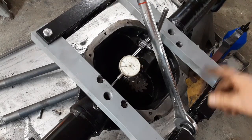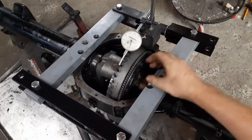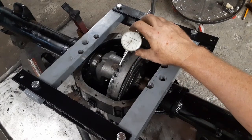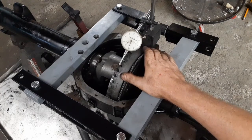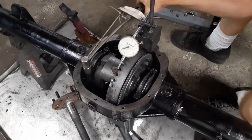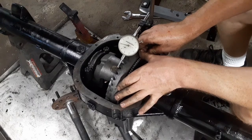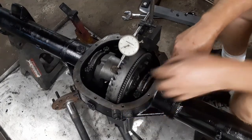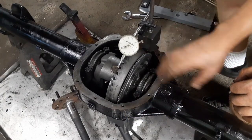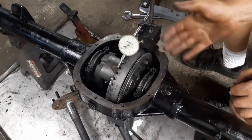So we'll go ahead and drop our carrier in. Alright, I got the carrier in and I've been messing with the shims a little bit, getting adjusted. Right now I'm right around 10 thousandths backlash, so I'm going to install the caps, torque those down, and see if that changes much. Looks like it tightened up about a thousandth on me, so I'm at 8 thousandths, which is on the tight side by 3 thousandths. But that's fine - I'm going to use this to check the pattern, because like I said I've got to take all this apart and change those bearings anyway. So this gets me real close and I can see how my pattern is. The pinion shim is basically what I'm measuring right now.